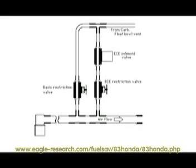The idea is to lower the absolute pressure in the float bowl to prevent the fuel from going over into the venturi and into the engine. If you put enough vacuum there, you'll absolutely shut off the fuel going from the carburetor into the engine. This is a different way of shutting off the fuel than using the anti-dieseling valves I pointed out earlier. My later schematics can go either way — people can use either electronic shutoff valves or simply apply vacuum to the float bowl.